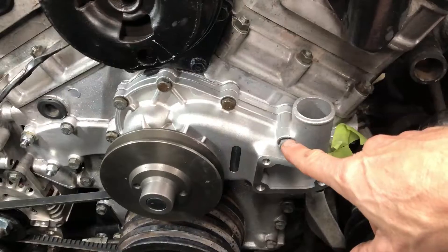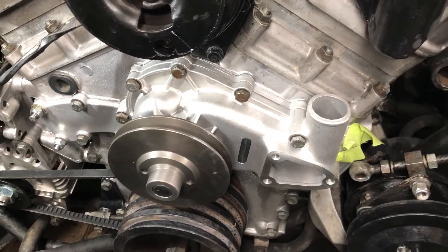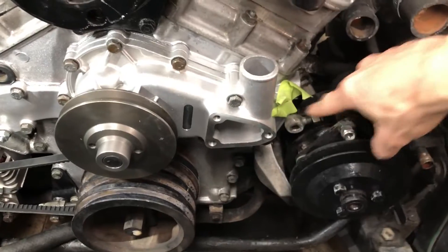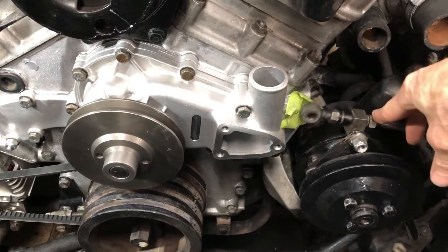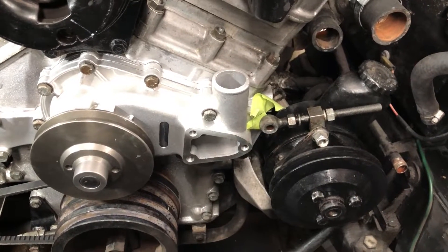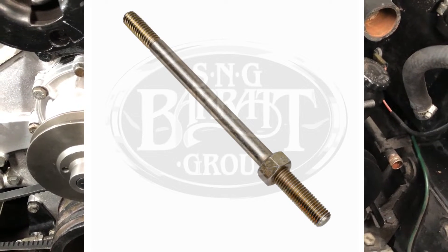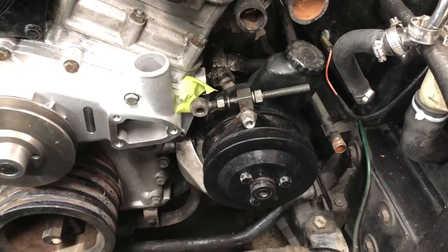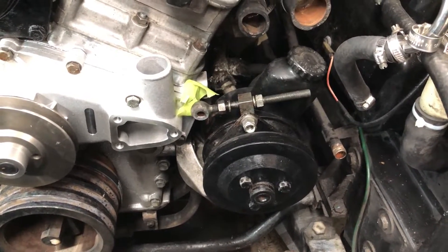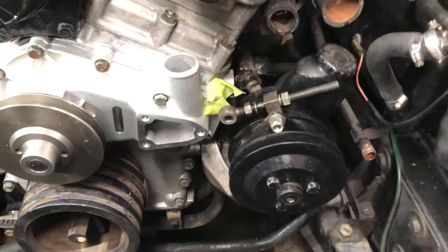So a new water pump. The old water pump was okay but since I was at this point of dismantling components and had access to it, I changed that. There's a stud here which the power steering adjustment goes on to — it was a stupid, stupid mistake. It's the one component I've broken. I didn't actually have to take the nut off that I was trying to remove, which is a captive nut anyway, so it's a stupid thing to do and they're a nightmare to source. Don't break that — don't lose that very long stud that goes through the water pump and through the power steering adjustment mounting.